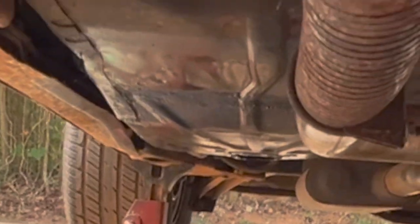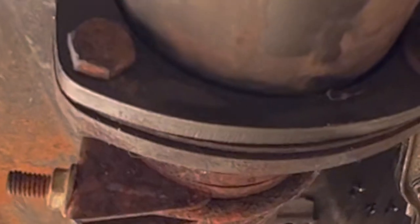It was kind of a pain because we just got some makeshift exhaust. This used to have a big block — it's been a true Oldsmobile 455 — and the headers were completely different, they went way back here with a header extension. So we had to use this temporary pipe to get the car going, but that's stuff for down the road. So we're going to get the transmission, lift it back up, put our cross member back in, then the driveshaft.